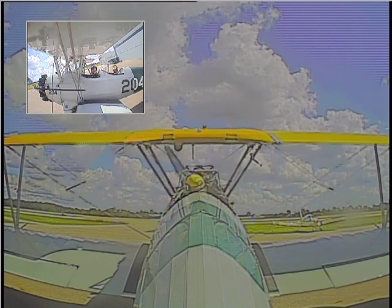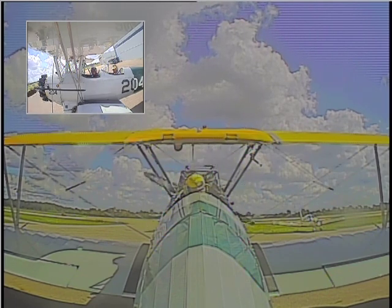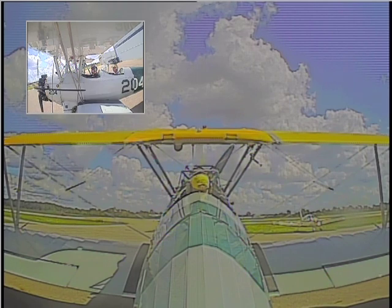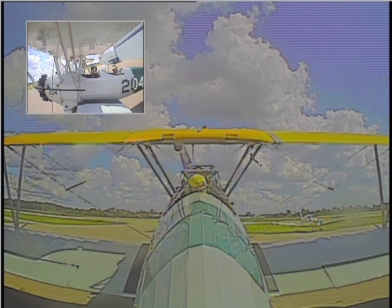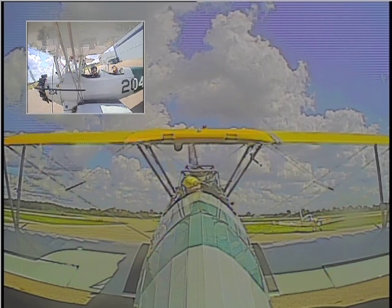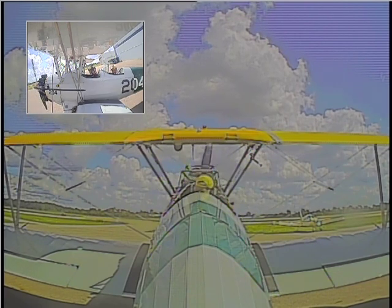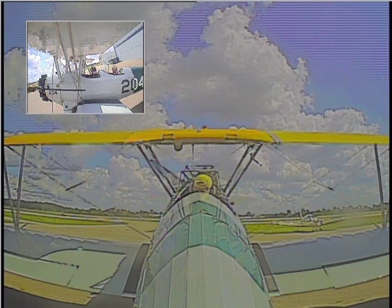Mixture is inside the cockpit on the left. I went over all this with you twice before. And then your fuel valve is on. I usually just leave the fuel on at night with this because the carburetor doesn't leak. There's some of these engines, the carburetor has a tendency to kind of leak, so drip on the floor. So you turn the fuel off at night. This one doesn't do that, which is good. A is accessories, elevator trim tab is underneath the throttle. Yep. We don't need carburetor heat. That's this little guy right here. It's too hot to get carb ice today.